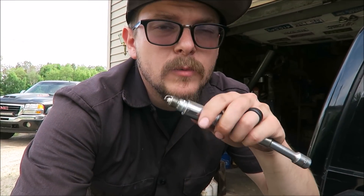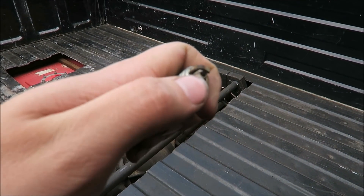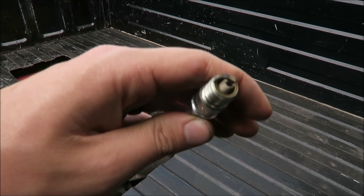It does look like there's discoloration for a timing mark real close to the bottom, unless I'm just misreading this. When we put the two extra degrees in it yesterday it didn't like it — that could be because it's running out of fuel, or because the vacuum advance wasn't hooked up. Maybe we should just put the locked-out distributor in it. The easiest thing to start with is putting two more degrees in with the vacuum advance hooked up and see if it still stumbles. The two degrees on the other plug put the timing mark almost perfectly.